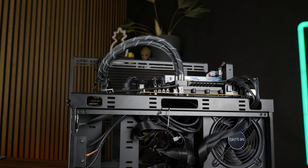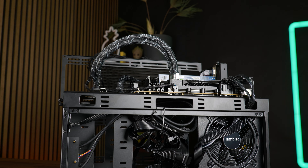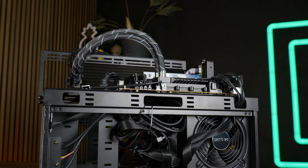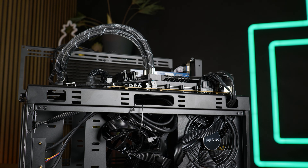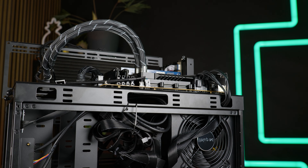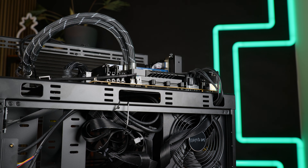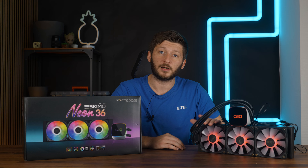Using this poor little thing, we created three scenarios: a low workload at 120 watts, a mid to high workload at 250 watts, and a god-tier workload of cooling this down at 320 watts. To get our numbers, we switch between the different modes in BIOS with pretty much every imaginable setting locked down. Then we hit the CPU and wait about 15 minutes until the cooler reached what it can do over a permanent time span. This is especially important on AIOs because it takes some time before the water can really heat up.